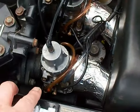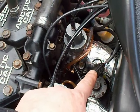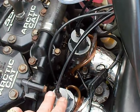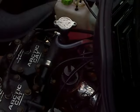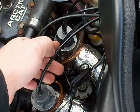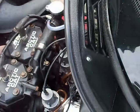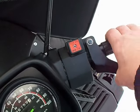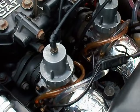When you're at an idle, you have magnetic switches on each carburetor that complete the circuit for you. But as your pistons come up inside your carburetors, it breaks that connection, and that's where your TSS switch takes over — in case one of your pistons is up or hung inside your carburetor, so the sled won't run. But I don't fear that will ever happen; I always work my throttle a couple times and I can hear those pistons hitting the bottom.